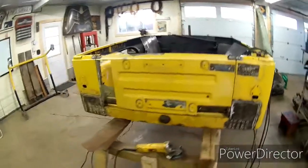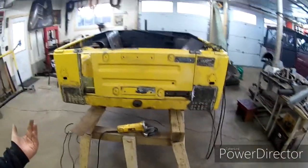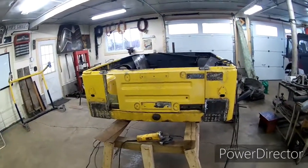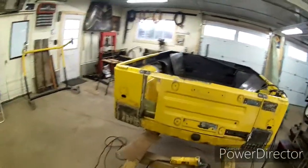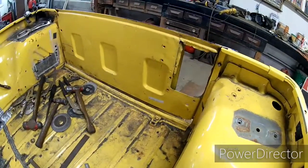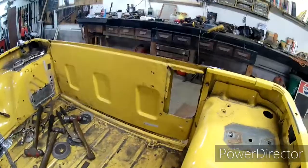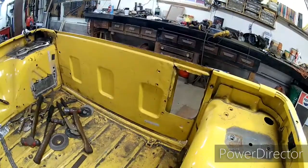That's going to close in both sides on the front of the tub. We'll fill the gap in with a few welds and patch the bottom so it'll be closed in across. The reason we decided to do that instead of having an opening tailgate is this is going to take a lot of water off the back of the Jeep. We just didn't want another spot for water to get into the trailer, because the eventual intent is to have it covered. On the inside, that big part sticking out for the latch - we took all that off, cut away some of the sheet metal, and we're going to patch and smooth it out.